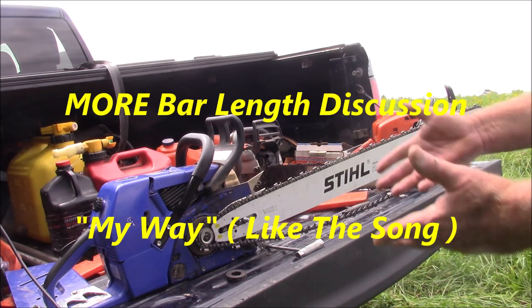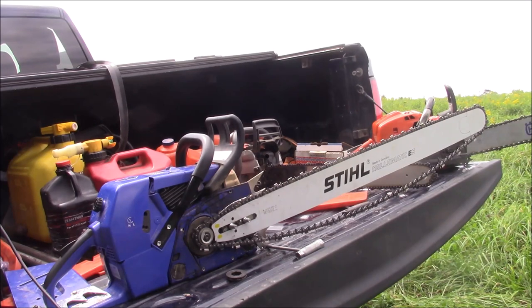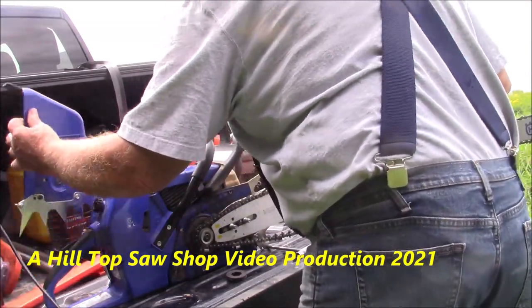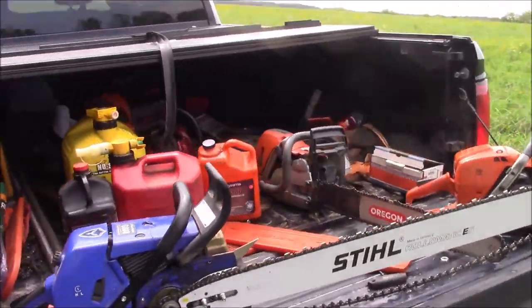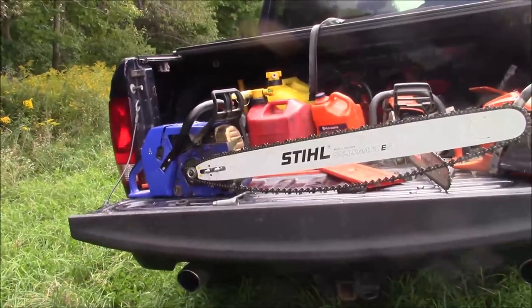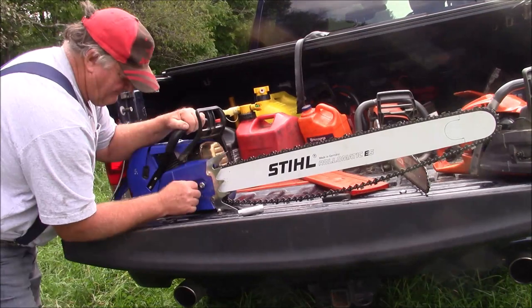And since I'm going to move this saw into the large 36 inch bar world, going to a 7 makes sense anyway. So it's something that had to happen. But it also explains why it wasn't oiling as well as I would have liked with the other bars as well, with the 8 pin. So let's just get this.